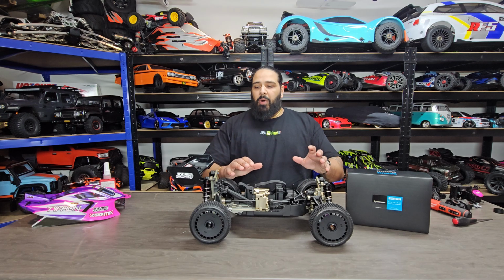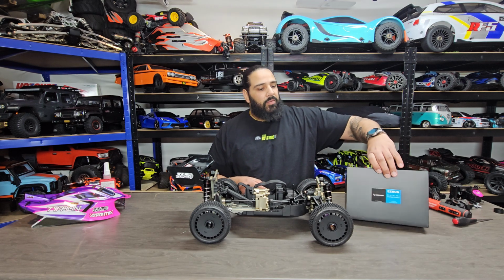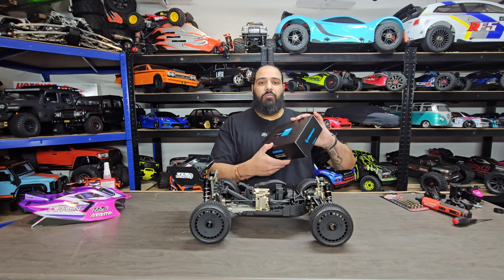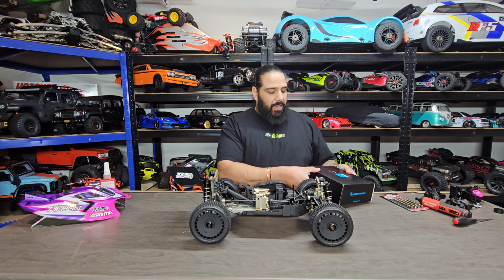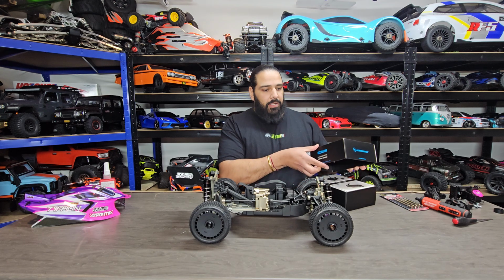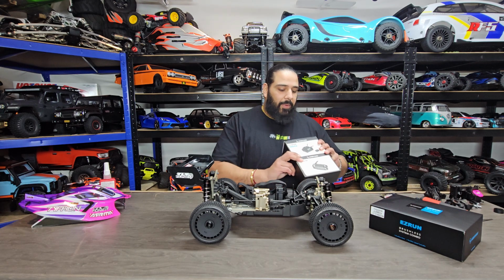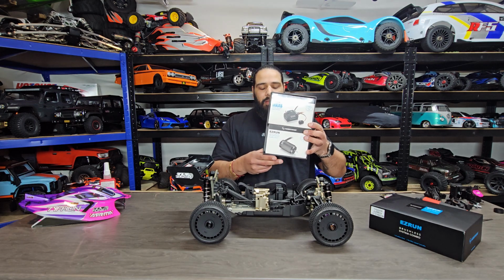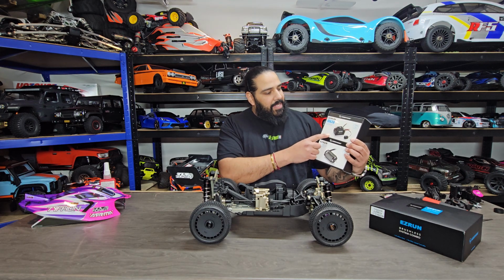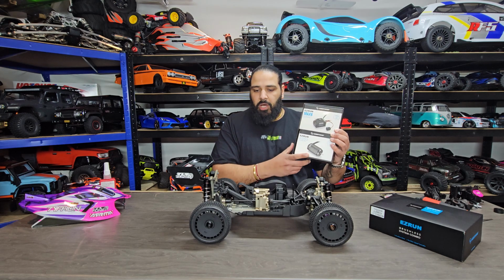So all the Vitavon parts are now on the vehicle. The next step I'm going to do is get the Hobbywing brushless combo system out, and we're going to attach the motor onto the motor mount. So here I've got the Max 6 set up, as you can see. So running a Max 6 ESC, and we've got the EasyRun 4985 brushless motor to go in.